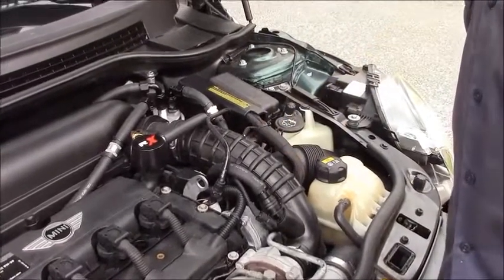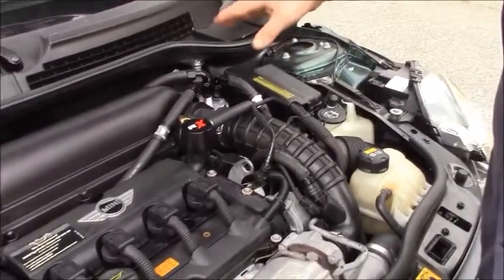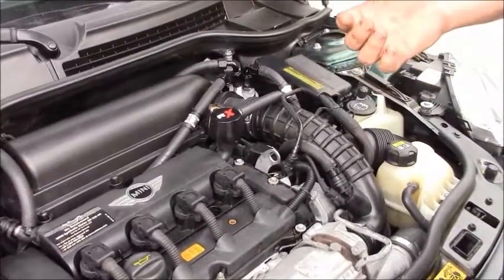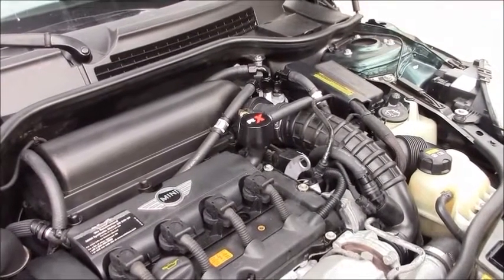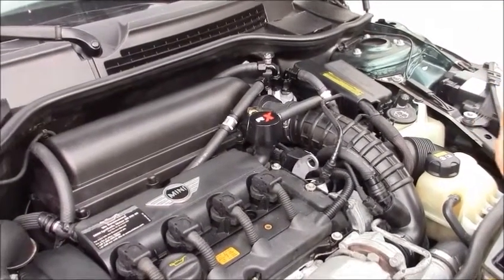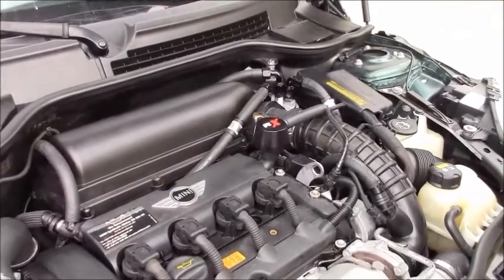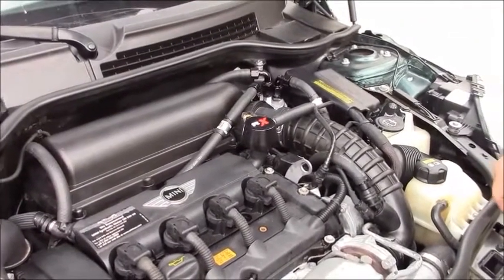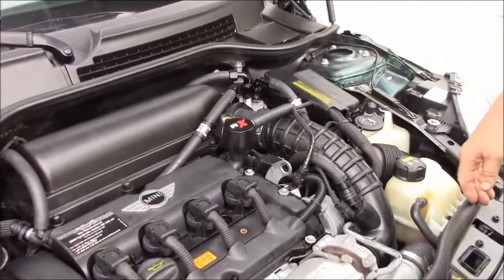We also did a crushed walnut shell media blasting cleaning because this is over 60k miles on this. Intake valves, you couldn't even tell they were valves. It was so coked and blocked. So that usually is a couple-hour job. That turned into about a 4-hour job because of the severity, but we got them done.